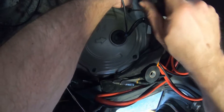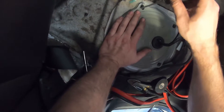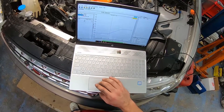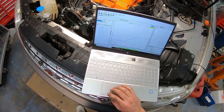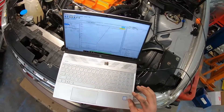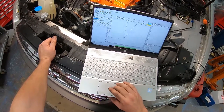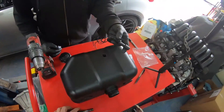Then it's just putting the cover back over the fuel sending unit, which is right under the rear seat in this vehicle just like in a G35 or 350Z. Up at the front of the vehicle I've got the laptop hooked up to the fuel pump voltage booster — super easy to set up. You can configure up to four independent set points, picking four different manifold vacuum or boost levels and setting corresponding pump output voltage for each. I've got it configured for 14.5 volts off boost and 22 volts on boost initially, though I'm sure it will get changed at the dyno.